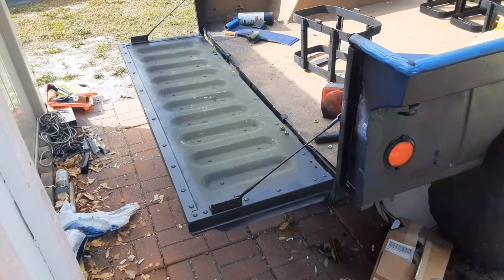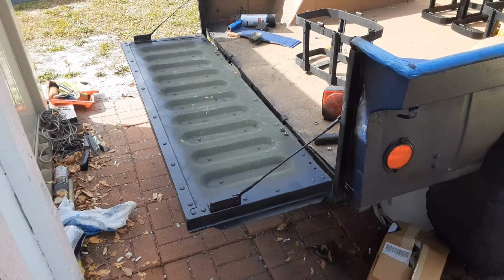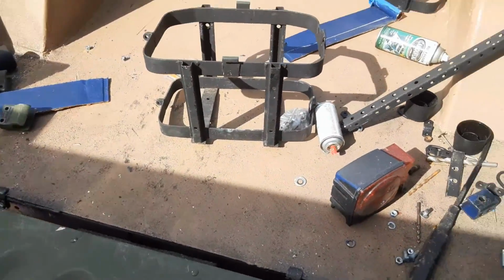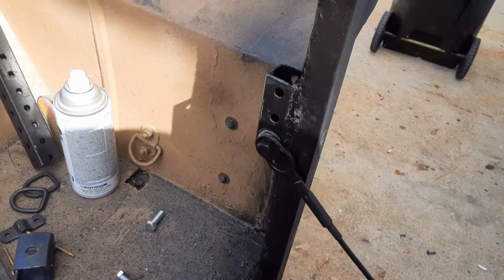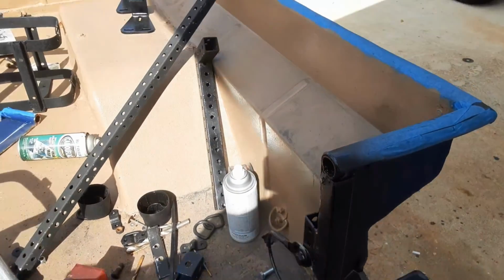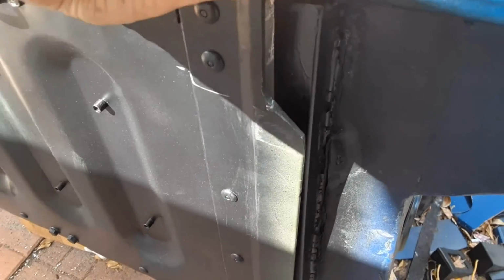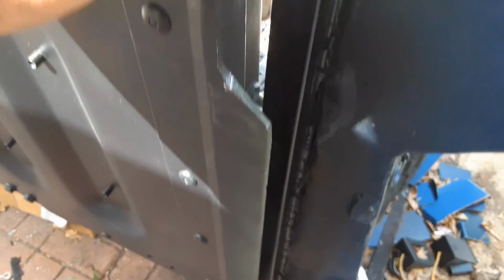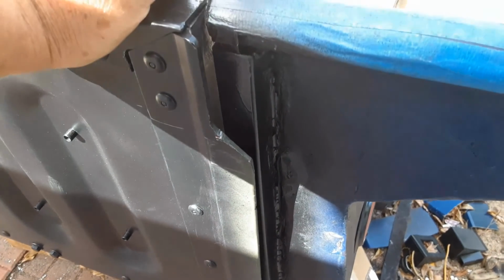Okay, as you can see, the tailgate's been installed. You know, I've inserted a screenshot of the brackets that we used, cable tie down points, etc. So here's the finished attachment point on the inside of the trailer. For the trailer to close, it's pretty light and simple. I did add a piece of square tubing here, right here, because of the design of this trailer. It's got that lip on the tailgate, so this gives it something more flush to sit up against.